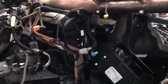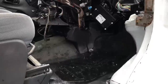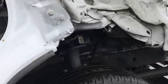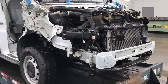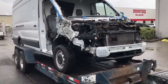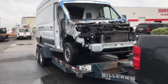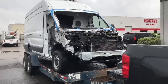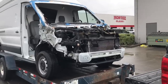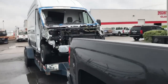Maybe something got wet. I'm trying to figure it out — it's not even clicking. The battery was good. So now I've got to take it home, figure out what the problem is, try to get it started, and hopefully bring it back here this week. Got to check all the fuses. We tried with the jumper and it wasn't clicking or doing anything.